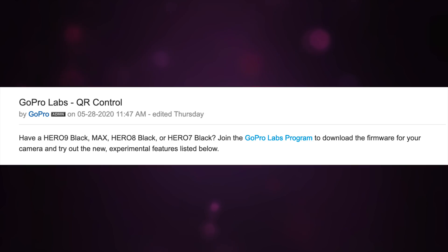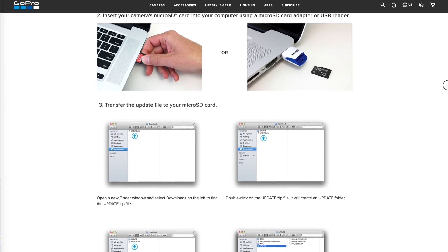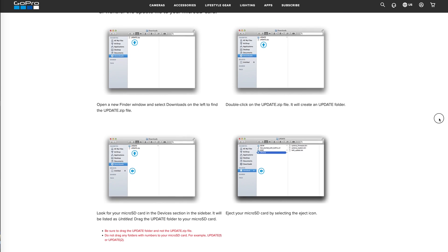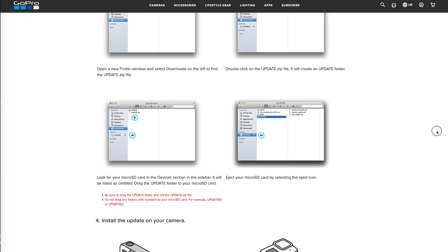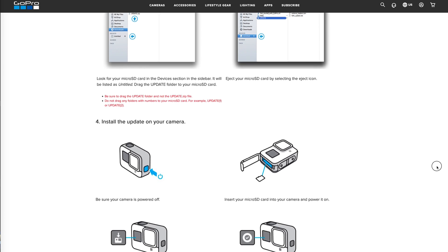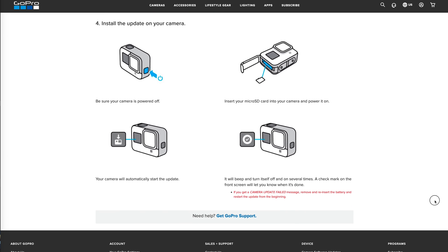To get this new feature, you must have a GoPro Hero 7, 8, or 9 — or GoPro Hero Black 7, 8, or 9 — and you have to install the special new GoPro Labs firmware onto the camera. Luckily, the installation of the Labs firmware is pretty simple. You just download the updated firmware, stick it on the SD card, put the SD card in the camera, power up the camera, and it'll automatically detect and install the new firmware for you.